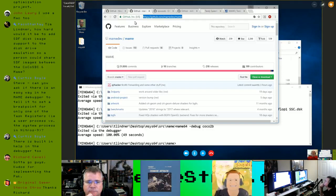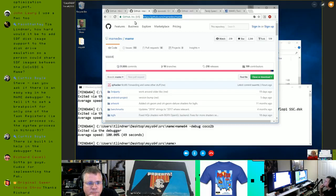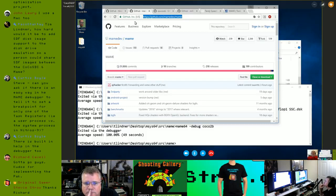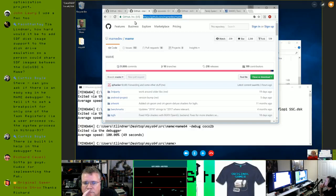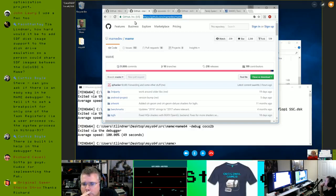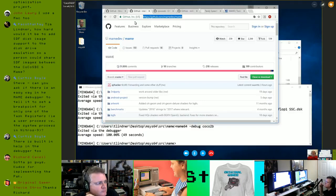We would have to check where the hardware ports on the parallel port and the hardware serial port are addressed, but I don't think those are conflicts. But I would actually have to check those addresses. Other than that, the differences in hardware are the hardware parallel and serial port. And if those don't conflict, then there shouldn't be any reason why a multi-pack would not run.